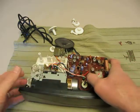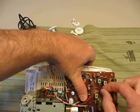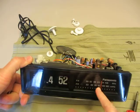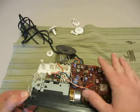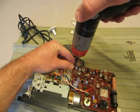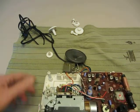Before it moves on me, I'm going to put the two red screws — yours may not be red — back in place. Sometimes what I'll do is fine-tune the radio: find a station and make sure it comes in about where it should. For example, if you know a station is at 100.5, you'd set the dial there and tune the radio by hand — though it does have to be plugged in, so be careful. Generally I don't do that anymore. This radio plays very well; there's another video showing that. Most people aren't using it for listening pleasure, they just like having the clock, but if you're going to have a good clock, you might as well have one that plays well.